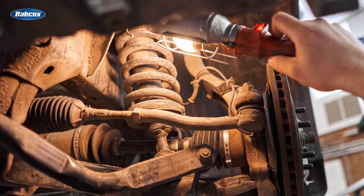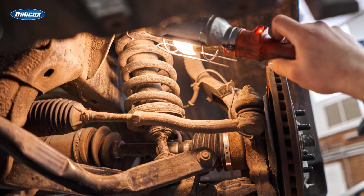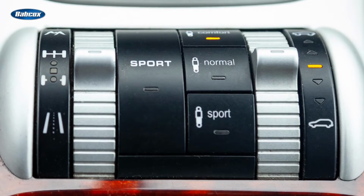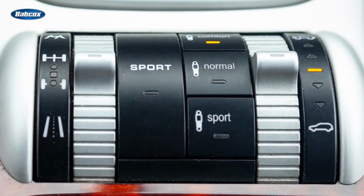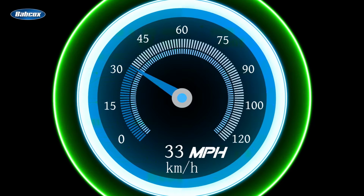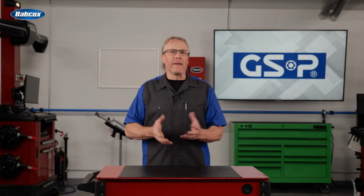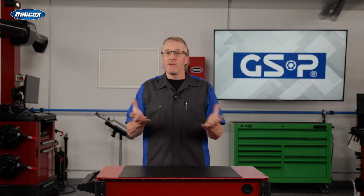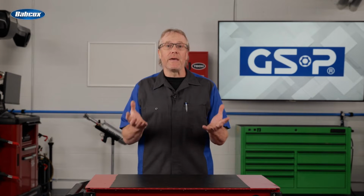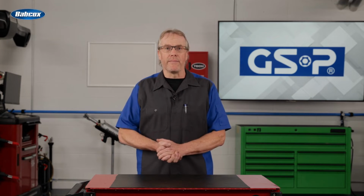After a test drive, begin your inspection with a bounce test for an initial assessment of shock and strut condition. But keep in mind that vehicles with active or adaptive suspension may have different dampening rates that are only active when the vehicle is running or can change with speed, and it's a good idea to refer to manufacturer testing procedures on these vehicles. Before lifting the vehicle, it's a great idea to take a quick ride height measurement simply to compare ride height from side to side. If there's a variation, it could indicate a worn or broken spring.